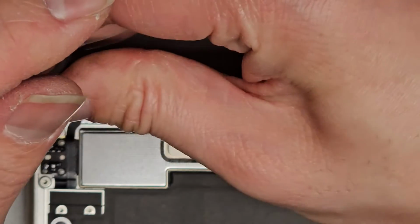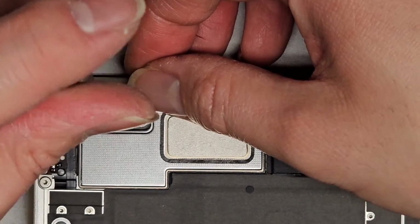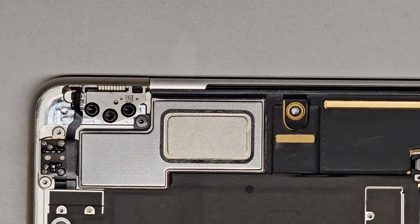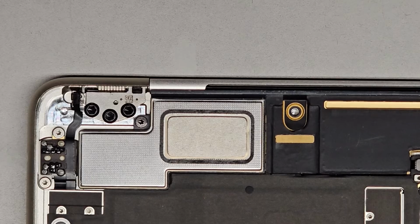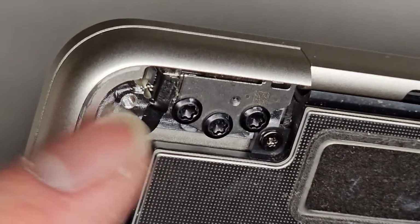Yeah, I don't know. Is it coming out? No. Yeah, I don't know. This screwdriver, it's not seeming to work. That's a T2, Torx 2, and doesn't seem to want to come out. So I don't know, because if I can't get that out, I'm not going to be able to finish working on this, because that holds this little Hall effect sensor on there, and if we can't get that out and transfer that over, then pretty much the computer's not going to do anything.